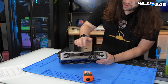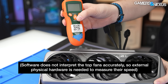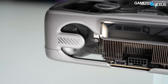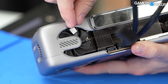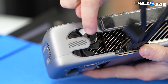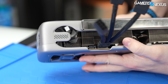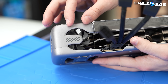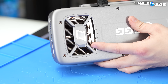Here's the card closer up — those two fans we've been talking about are right there. We've got a sticker there and we can use either a simple laser tach or a more advanced tach, and either solution will give us the fan RPM when pointed at the sticker. Basically, the air from the front before it hits the fin stack at the very top edge is able to hit this fan. If this fan is overpowering — which is typically unlikely since it's pushing against something much more powerful on the front — then it would pull air up immediately. They might get a little more efficiency with a dam in there to block airflow and force it straight through.